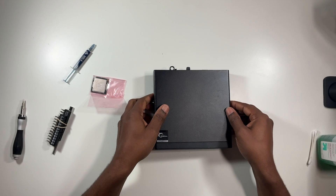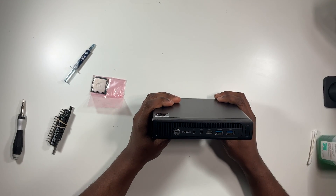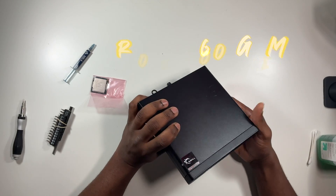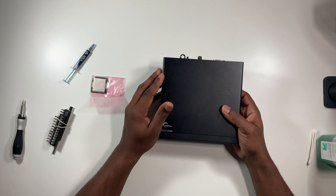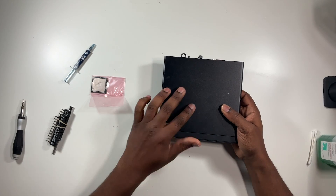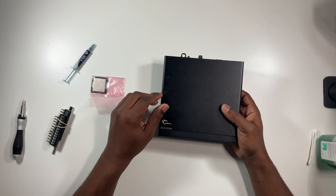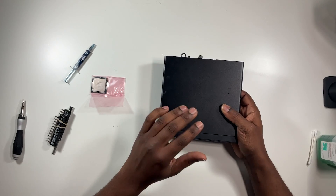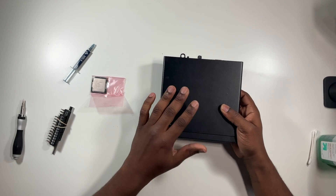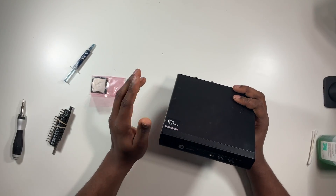What's going on YouTube, this is Charlie Eugene back with another video. Today I have an ultra small form factor desktop by HP — this is called the ProDesk 600 G2 Mini. I got this at Micro Center for about $150. I want to show you guys how easy it is to upgrade this system. I'm swapping out the processor — it came with the i5-6500T and I want to put in the i7-6700T. I've already maxed out the RAM, already got M.2 in here, and a 2.5-inch drive I'm taking out.